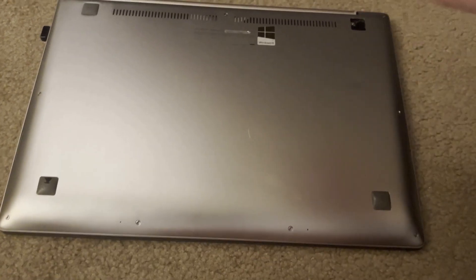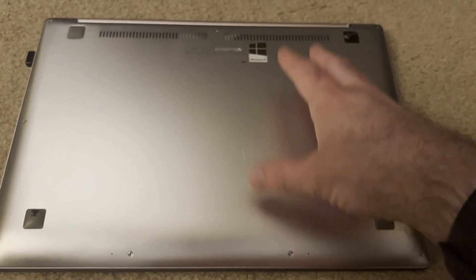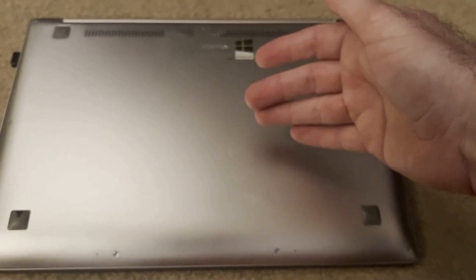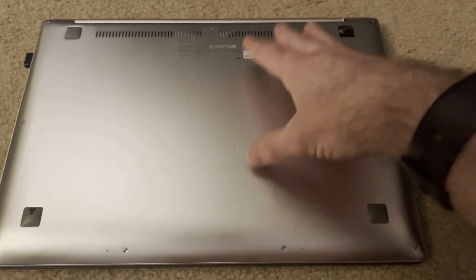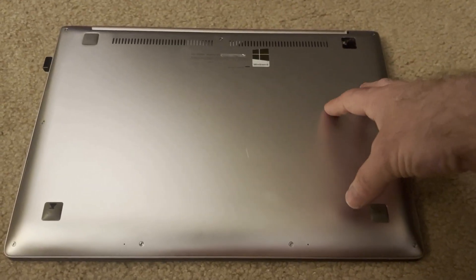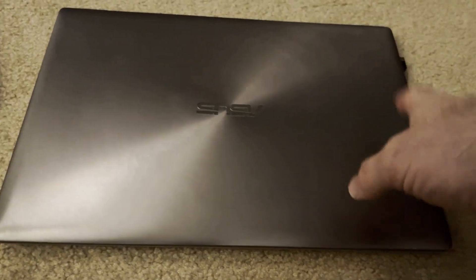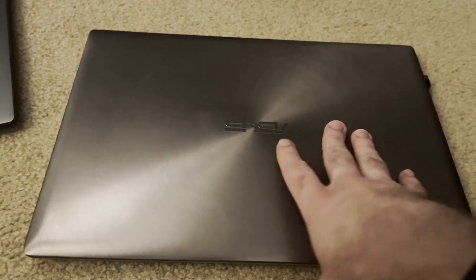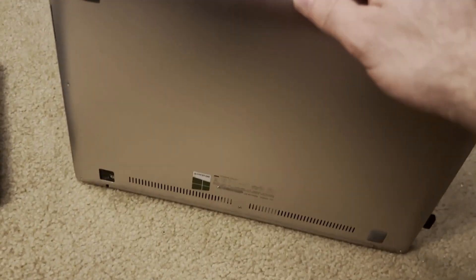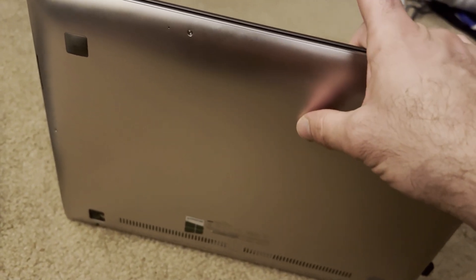This test would be applicable to, say, a MacBook Air if you did that thermal pad mod to it, or any laptop where you're attaching thermal pads to the bottom. It's worth noting that you would not do this mod on a laptop you plan to use as a laptop — it would be for a desktop replacement, because most modern laptops have thermal sensors on the bottom of the chassis to keep them from burning you.